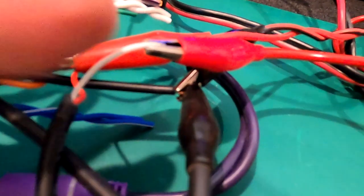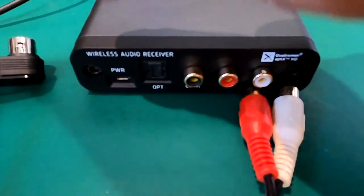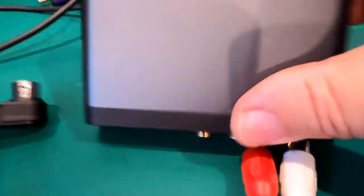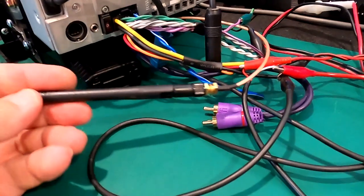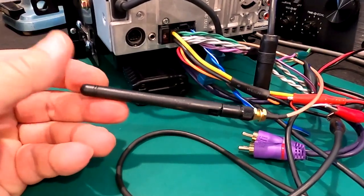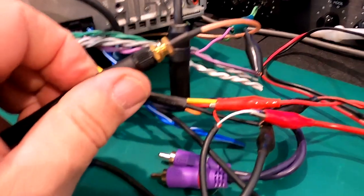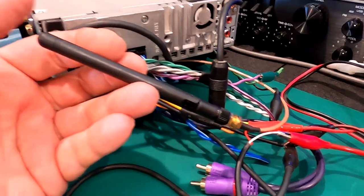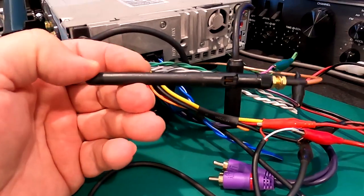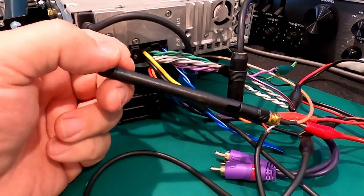That cable plugs into the power cable, so now we have power and audio. Then we need an antenna. This particular unit has the antenna built in, but the one in my kit has an external antenna. I've used the antenna that comes with the Bluedento B2 with an SMA to SMA micro coax adapter — about a 12 inch long adapter. We're going to stuff this through and hide it in your dashboard. Don't worry about it being around metal and wiring — you'll still get at least a 40 foot range.